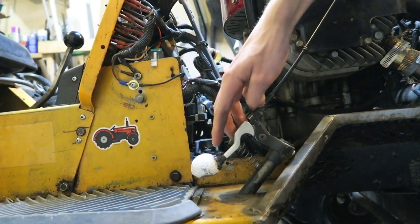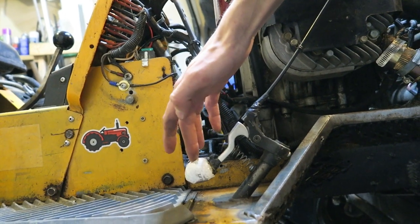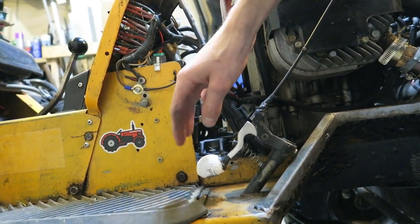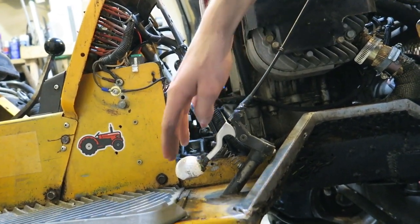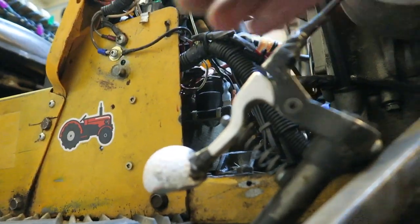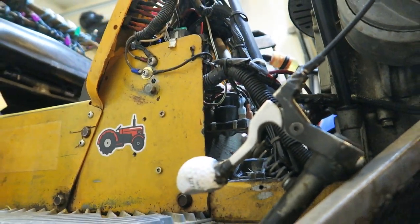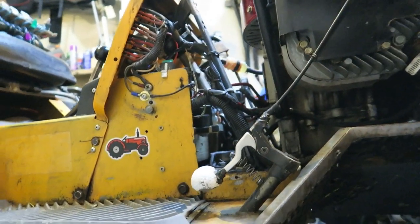The thing I like to do is add a little bit of play onto my pedal, so that when I'm mobbing down the trail and my foot's sitting on here vibrating — because this is a solid mounted machine with no suspension — my foot's going to be going up and down without actually revving up the engine. If I want to rev the engine, I just push a little bit harder, bypassing the spring and getting past that little bit of leeway. This is a huge mod that a lot of people don't really do, but if you're doing a lot of trail riding, add that little bit of play in there — it will definitely help.